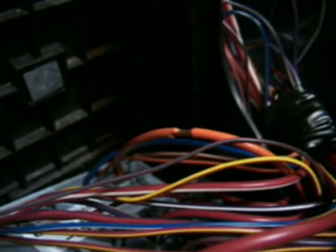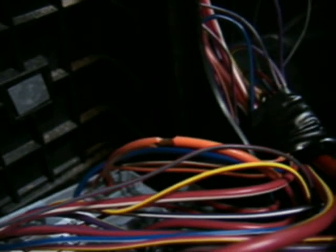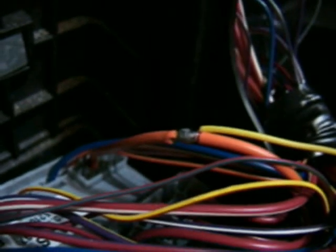I've removed some of the insulation from that orange wire, very carefully with a razor blade, being careful not to cut any of the conductors. Now I'm going to take this wire, wrap it around the bare wire, and then solder it. There's the wire wrapped around the orange conductor — next step is solder. Soldered. Wrap it with some tape and we'll be good to go.